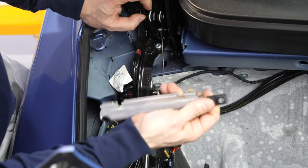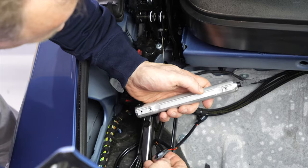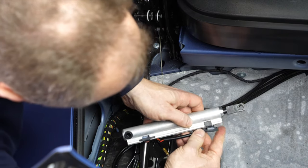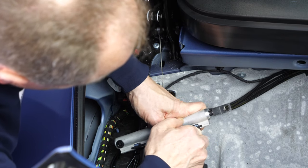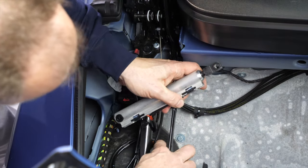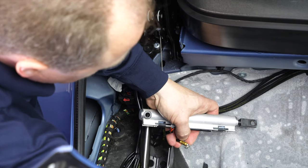Before we do that, let's use a little bit more freedom here and first attach the travel sensors and the hoses. Really easy. The travel sensors just clip back into place. One and two. And you want to make sure that they're in all the way, that there's no major gap on the bottom of these travel sensors. Then remember what I said about the hose numbers, number 12 on the bottom, on the blunt end.